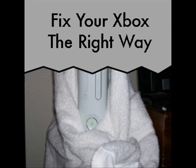The idea of the towel fix is to wrap your Xbox completely in a cotton towel and then run the console for 10 minutes. The towel will preserve the heat of the console, partially melting the solder joints and causing them to re-establish a better connection, thus getting your Xbox 360 to run.